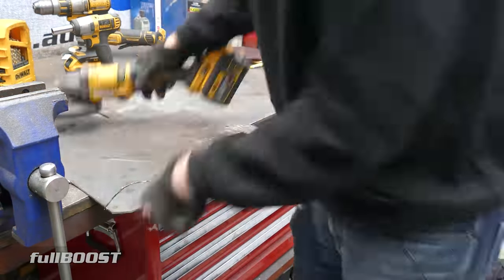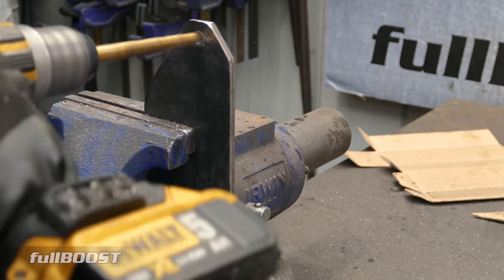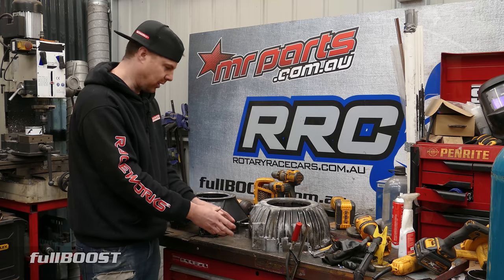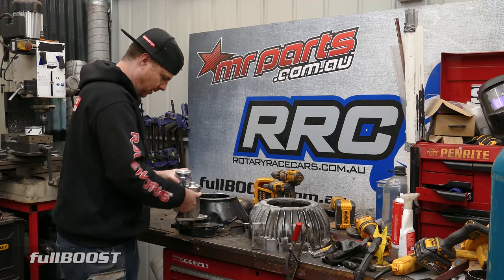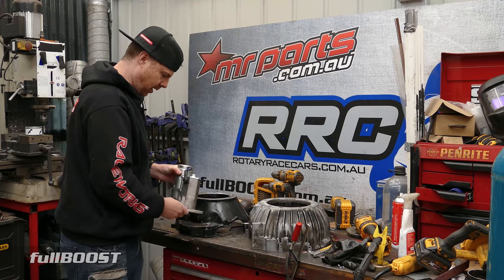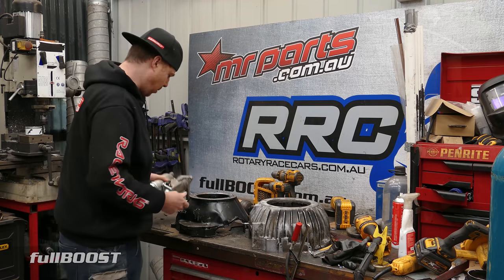The reason I'm having to do this is because the FD auto factory bell housing has a much different starter orientation than it does on an earlier engine. Just like in the manual, the early autos mount the starter motor just here. Because they mount there, it's much easier to work on and get in and out - they're less bulky and less ugly.